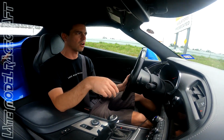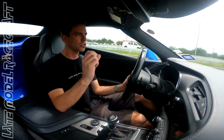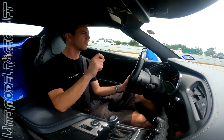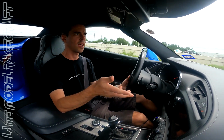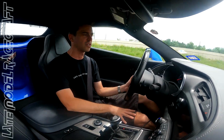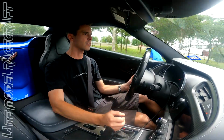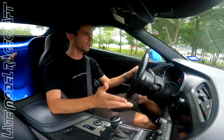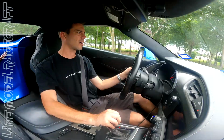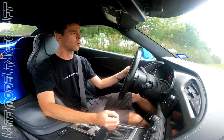Obviously we changed the lifters out, got rid of the displacement on demand, lower balancer, spin the supercharger just a little bit harder than factory, and a cold air intake. Basic, a few little bolt-ons and a camshaft on 93 octane. On our dynos, y'all know, automatics are usually around 535 rear wheel horsepower stock. This one, I think it finished up right at 615 rear wheel horsepower.